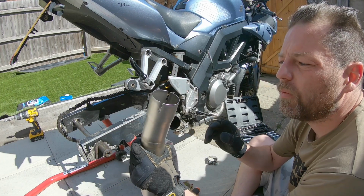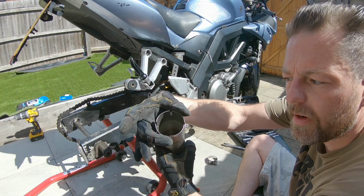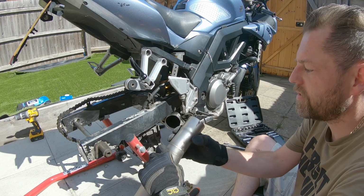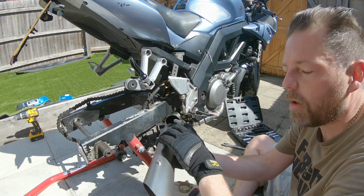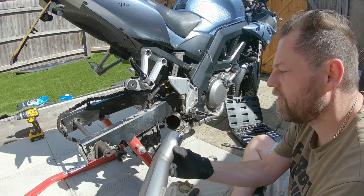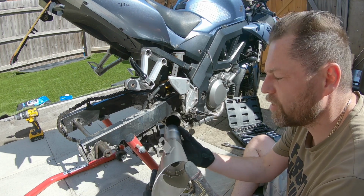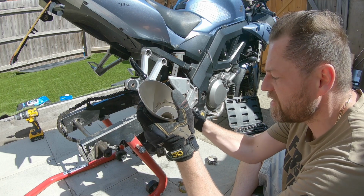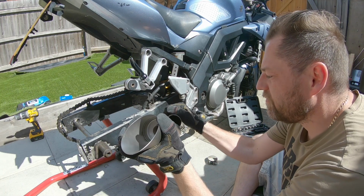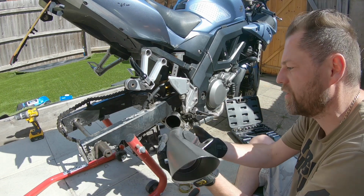Right, so what I've worked out is, because this wasn't round, I had to flare. I need to flare these that way and that way to fit on that, because that is pretty much the same size. So what I did was, I went like this. Bit of pressure up. Obviously the harder of the two metals will prevail, but if one goes in and the other one goes out, happy days. Worst case is I'll close that in by doing it on that side as well.